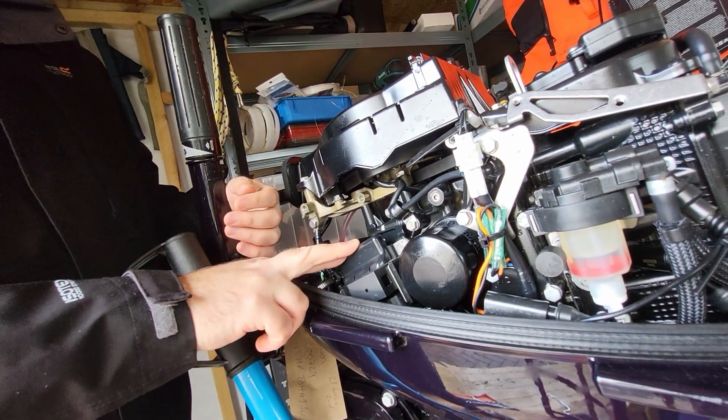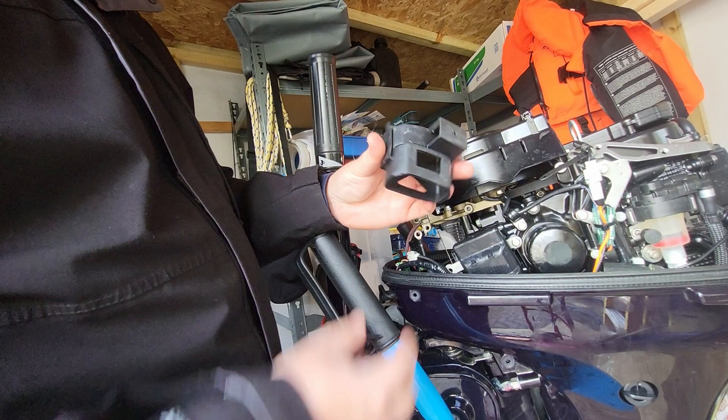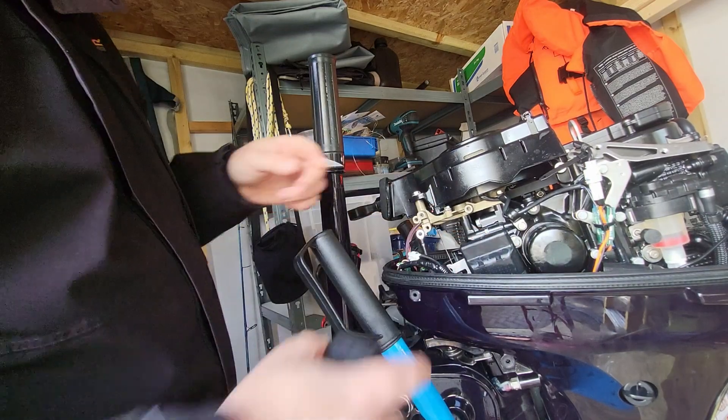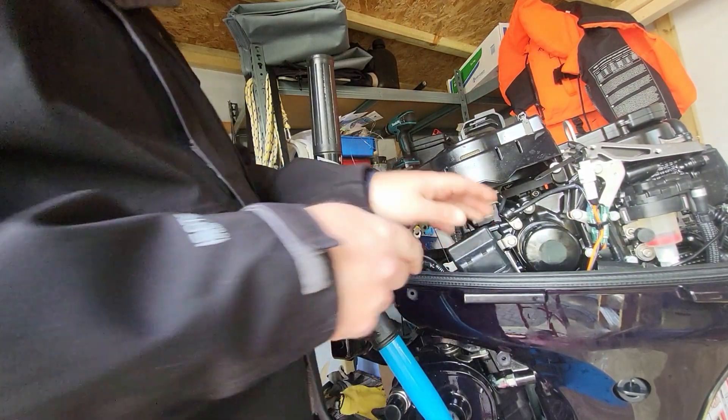Here's the ECM. I've heard this can be a little bit tricky — this is awkward, to say the least. There's the rubber housing — that was a pain in the butt. You can see those slots there; that's where it slots onto the bracket. Now I can see the clip I need to press in. Those several cables connect to a small clip, just to the left-hand side of those coloured cables, that I need to pull out.